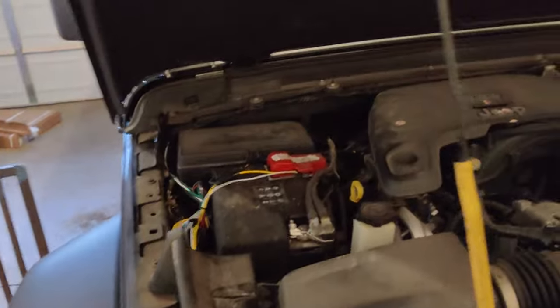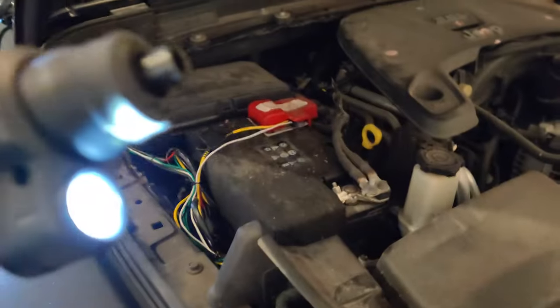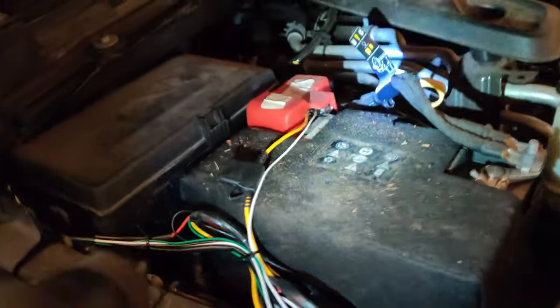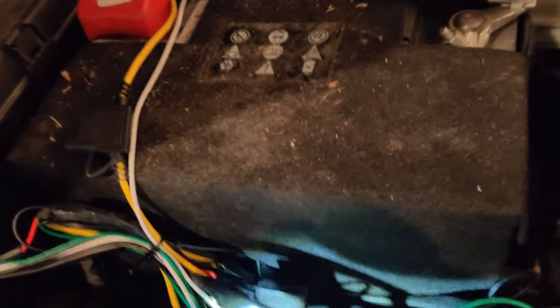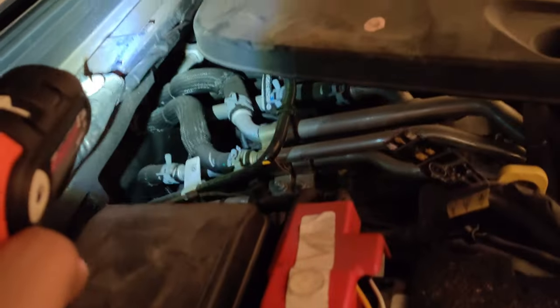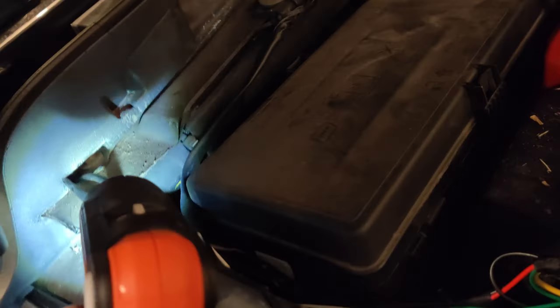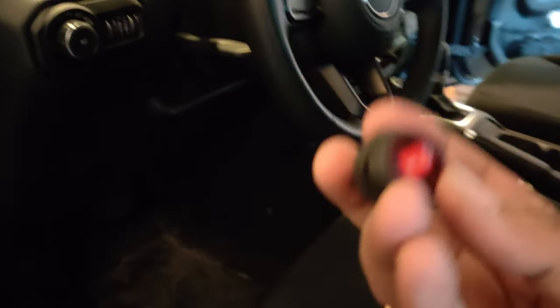Before fishing the wires, I'll mention my tools — a Black and Decker power screwdriver is very helpful, and a torch is a must since natural light doesn't reach. I've tied all the wires nicely and tightly. The yellow and white wire connects to the battery and attaches to the standard relay, which I've tucked in. The black wire goes right into the cabin, and the other wire runs from the relay out to one spotlight and then to the other spotlight.